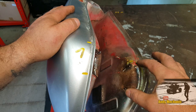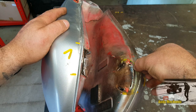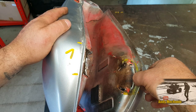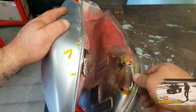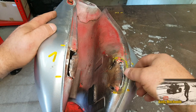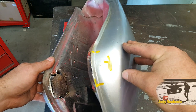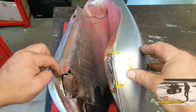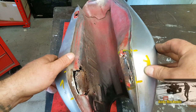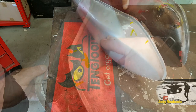We're going to cut out, and we'll make some new pieces, and we want to cut the steel so it's a nice sharp cut as opposed to this sort of chamfered grind that I've got at the moment. And then at least that way we've got maximum metal to weld to. Actually, it doesn't look as bad as what I thought it was going to be. Okay, so the next step, mark this out and do some cutting. And I might need to find the Dremel, see if I've got some Dremel parts, and then we can maybe cut it a bit easier.